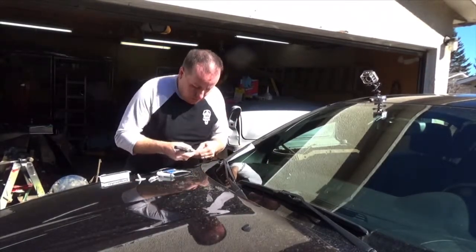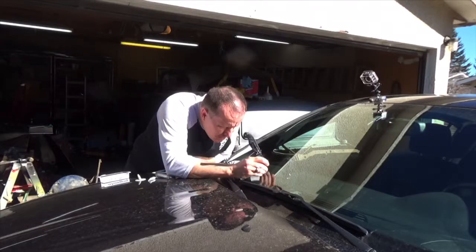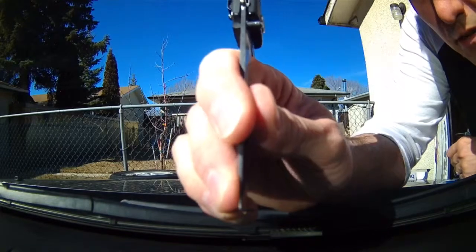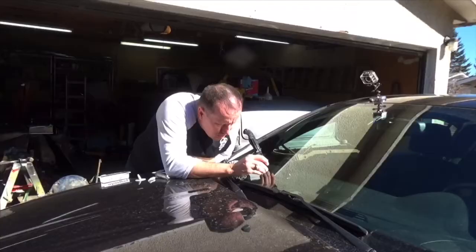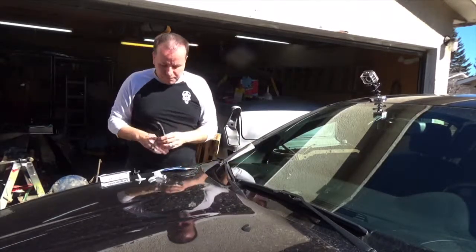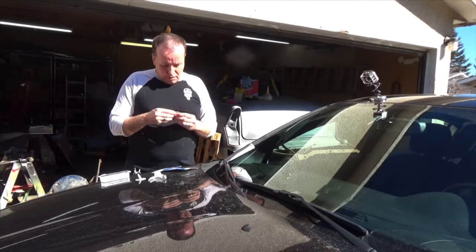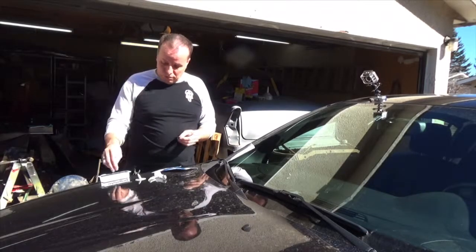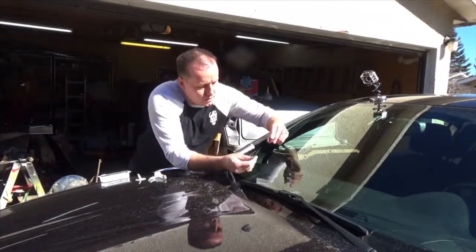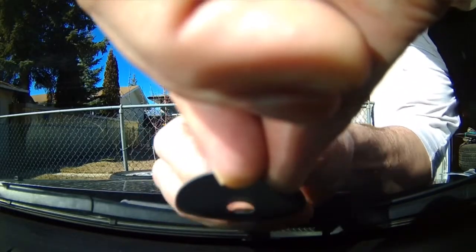Let's take the point of my knife. It says to use a pin, but I'll just use my pocket knife. Yeah, there's a tiny little bit in there. Don't break off anything that's kind of loose. Not very thick. Alright. Then it says peel the white side of this. There's a little circle, I'd probably push that out of the way. Peel the white side and basically try to center it over the hole. Secure it down.